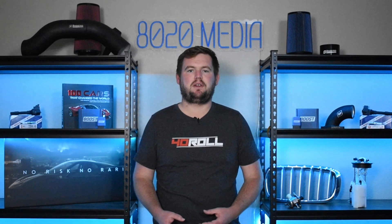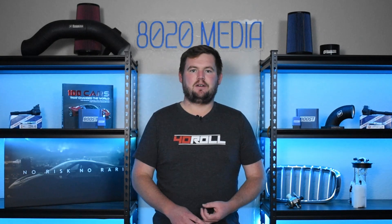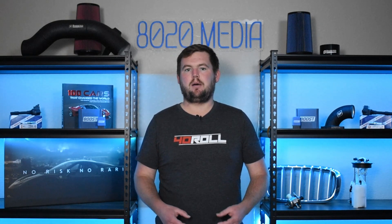They generally start to run into a few of those common BMW problems. But nothing serious — not really any design flaws or anything to hold against the S55. It's not even just BMW. Tons of engines are prone to various cooling issues, oil leaks, coolant leaks, etc. As they get to that 8 to 10 year mark at 100,000 plus miles, rubber parts, plastic parts, anything like O-ring seals, gaskets, and coolant hoses — those types of components simply tend to become brittle and degrade with age and mileage.